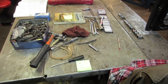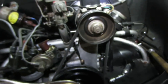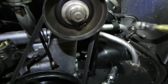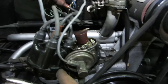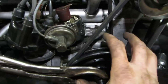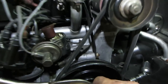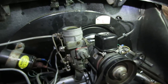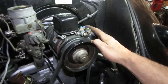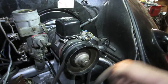One of the things we're going to do is a leak-down test, which tells you where your compression is leaking out — hence the name. What you do is inject air directly into the cylinder through the spark plug hole with the valves closed. The distributor is off and the rotor is pointed towards number two cylinder. I have vice grips holding the bottom nut to keep the crank from turning because the piston is at top dead center — you put air into that cylinder and it wants to push to the bottom. It can come out the intake, come out the exhaust, around the cylinder head, or if the rings are bad, it'll come out the oil fill into the crankcase.